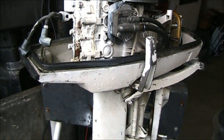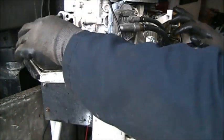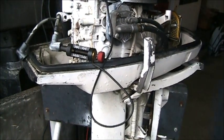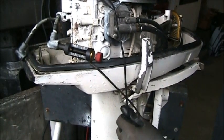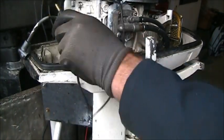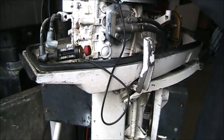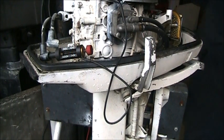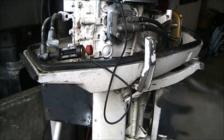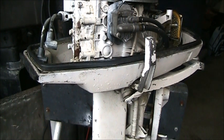Make it closer. Okay. Yeah, keep fire. So that is the top. Here's the bottom. And ceasefire. I've noticed these points and condensers have a whole different type of spark when you look at it. It's a thicker, fatter, yellower spark rather than a skinny, long line.